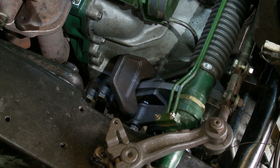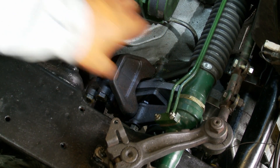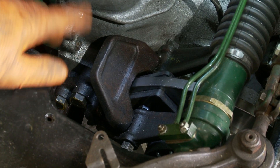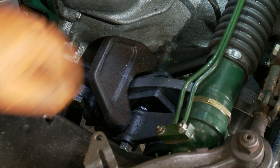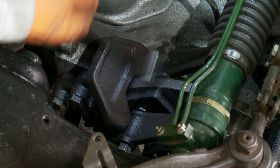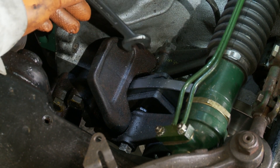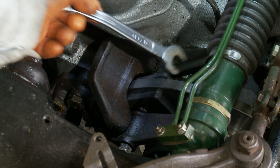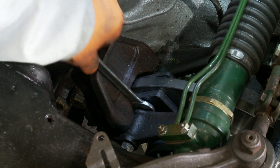Here is the parking brake caliper on the right-hand side of the car. We can actually see this one because it's a left-hand drive car and the steering column isn't in the way. You can also see that you can get access to the bolts and nuts to adjust the parking brake pad clearance, which is what I'm going to demonstrate here. There's a lock nut at this end and a lock nut on this side — this one is particularly awkward as you can only get an open-ended spanner on it. The other end, which is the bolt head, requires the special spanner, which fits in like that.